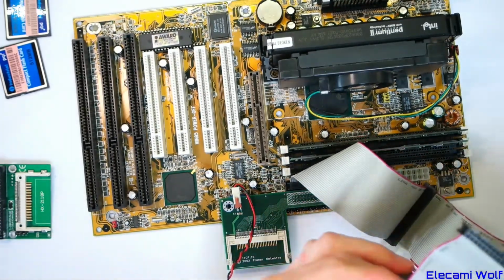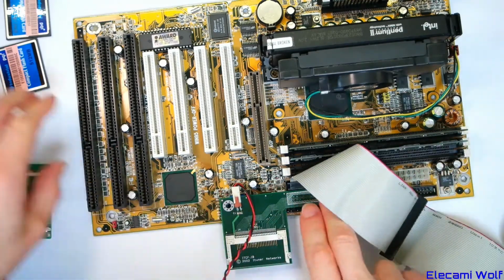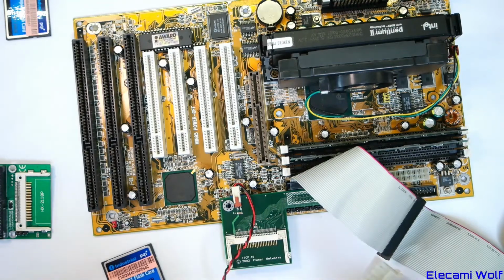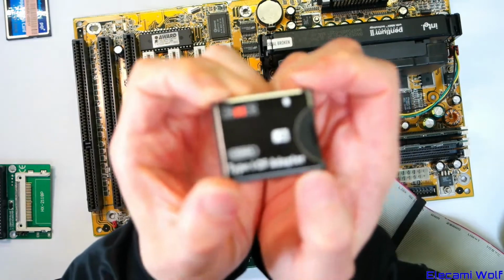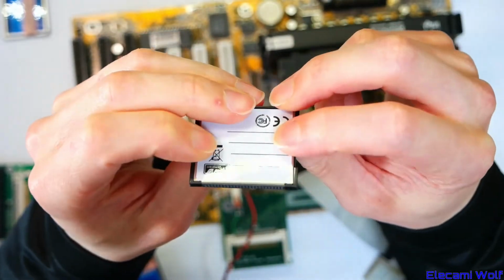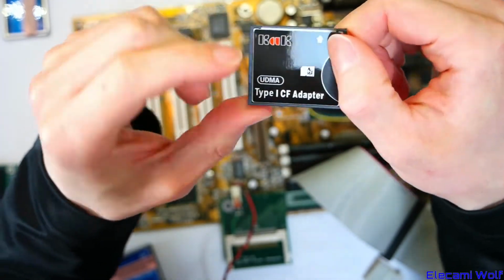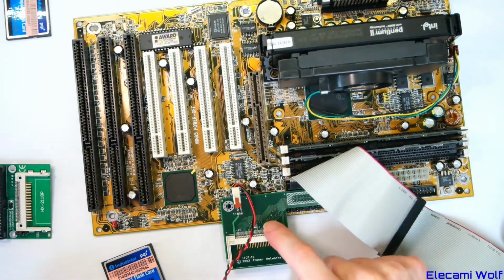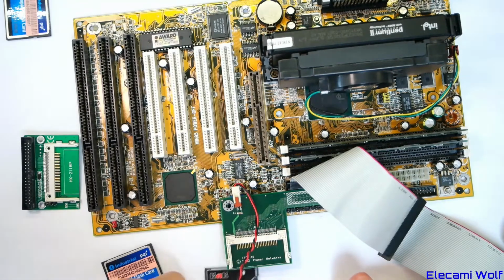And that means to start off with, we can put the CD-ROM on here and put a drive in here and see if we can get these to come up and format and work. But also I found this thing, which I think we tried in a previous video and couldn't get it to work, and reading up on that, it was something to do with some pins need to be pulled in the right way to get it to go to UDMA mode maybe, but we didn't try it in this, and maybe we didn't even try it in this, so perhaps we'll do that first.